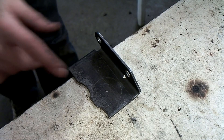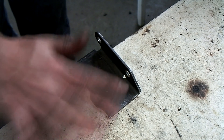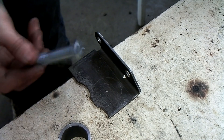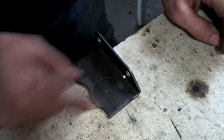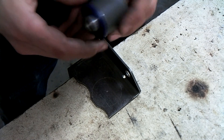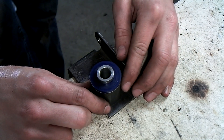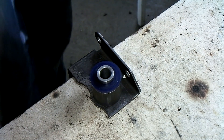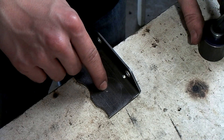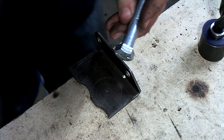I've set the camera up so you can see what I'm doing on this bracket. You can see this scribe line and where I want my housing to be on the inside, so I know where I need to drill my bolt hole. Now we need to find the center of this circle. The easiest way is just taking a housing, putting a bushing in and the steel sleeve, placing this on your scribe lines, then taking a drill, just turn it around a little bit, and there you have the center hole. This is where we're going to drill a small hole just to see if it's okay, and then we can drill a bigger hole for our bolt.